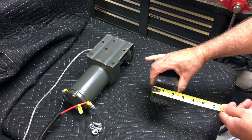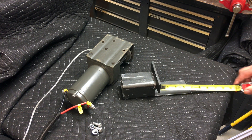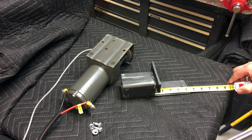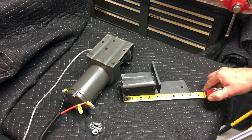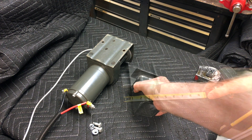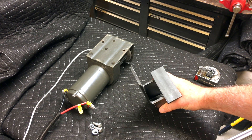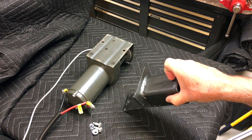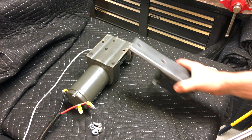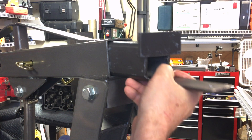I had two and a half inch square tubing which fits into the boom, and a piece that was just over eight inches long. The wall is one quarter of an inch. I cut three sides to use one end as a mounting plate. One of the pieces I cut off I used as a bulkhead while keeping the opening for the cable to pass through. Since this was welded tubing, I had to do a little grinding to get the seam out of the way, or this fixture would stick in the boom.